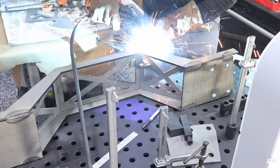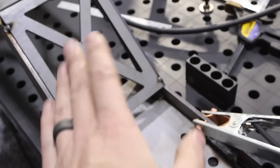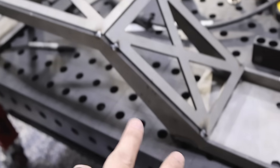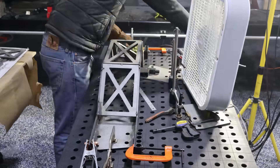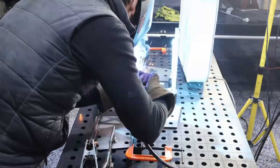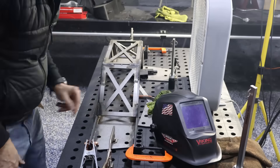Taking a quick break to catch you up. I started with tack welds on here while it was on the vehicle, then did a few stitch welds. I'm being really cautious because I don't want this thing to warp in any direction. Now I've got some structure and tacked it in several places. Instead of doing nice clean long passes, I'll cut it into quarters — do one section, then another — with a fan going to cool things down and a wet rag to soak up some heat.